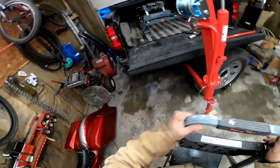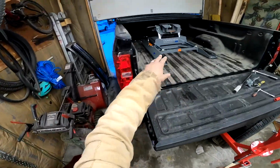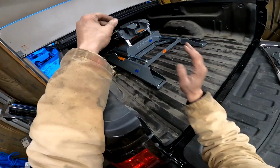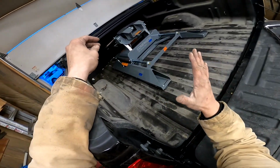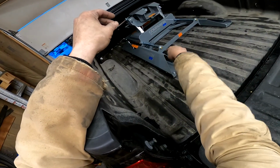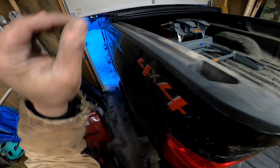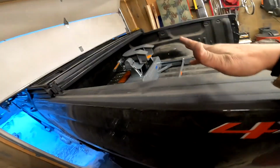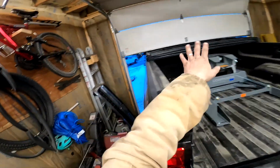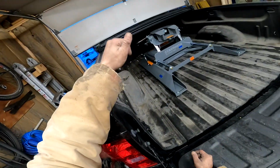So those top, you see those silver pieces on there? They are adjustable. You can take them and flip them around to move this further aft. It'll give you 2 more inches if you need, or the way I have it, it should put it centered over that goose ball, which is slightly forward of my rear axle. Should give good weight distribution, good handling in that position. Providing I have enough room to maneuver like that, it'll stay like that.